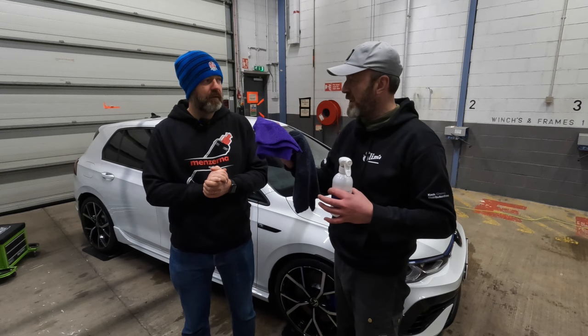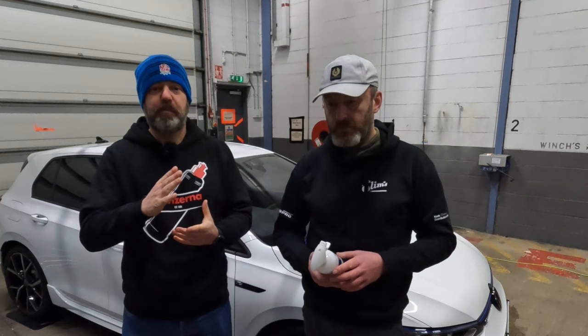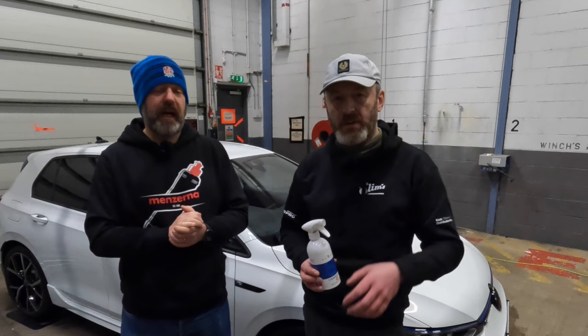Yeah, that was my finding. It was unusual when you come to panel prep that we needed two different sorts of microfibers. We could have kept going with the short pile, but when we switched to the long pile, it just took the remnants off, then it flashed off. Yeah, absolutely. It was a much easier process once we worked with the two different piles.